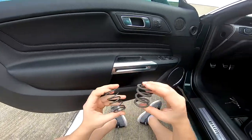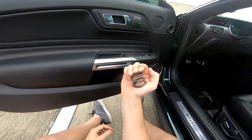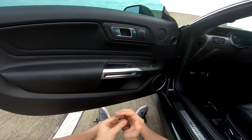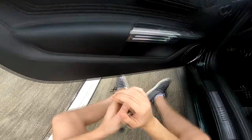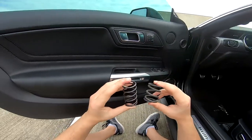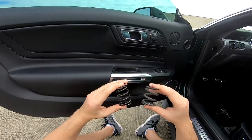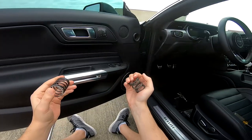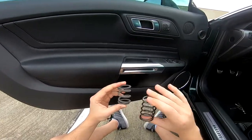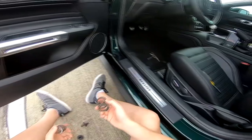Here's the difference — this is the OEM spring and it's really hard to press, even for me. This is the Steeda aftermarket spring and I can compress it almost all the way to the bottom. The OEM is 185 pounds of resistance, the Steeda is 35 — that's a huge difference. I can barely move the OEM with one hand. I'm hoping this removes the non-linear feel of the stock clutch.